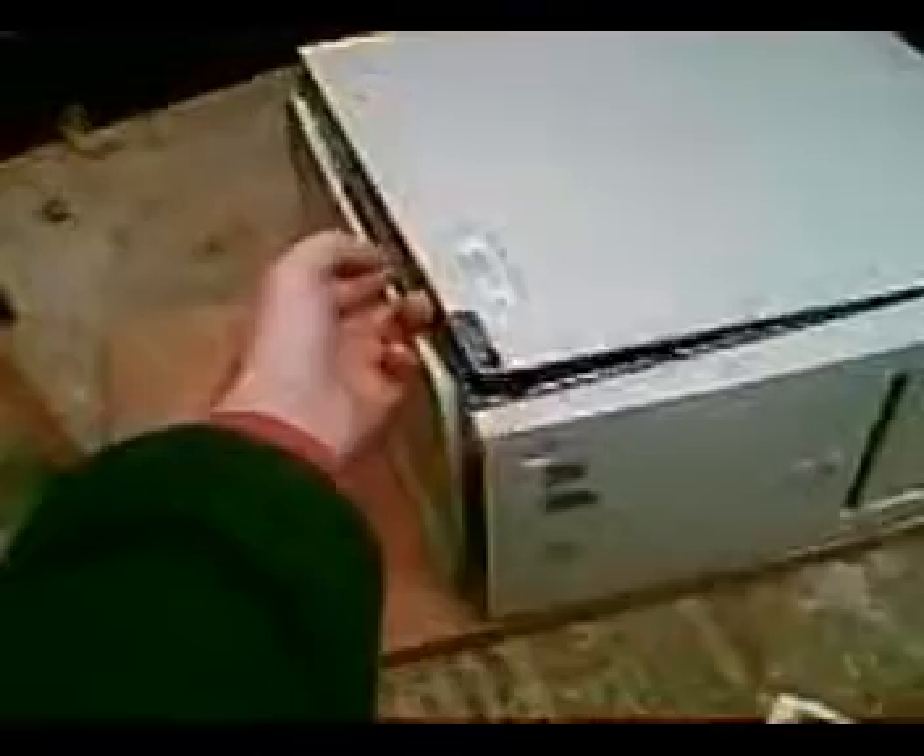I'm going to turn this computer on its side. Now the computer is on its side, press in this button. This then releases the bottom edge. If you look carefully, you can see that. I needed both hands to do that, so here goes. I've just pressed the button and it will lift off like so. It hinges back and you can remove that. Now you can have access to the rest of the case.